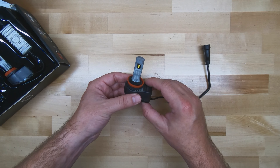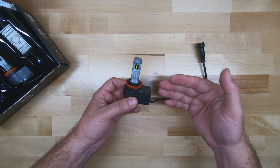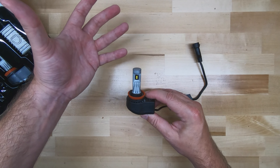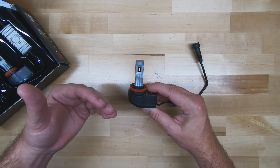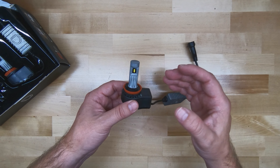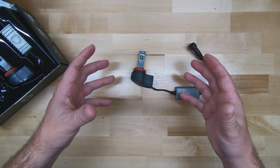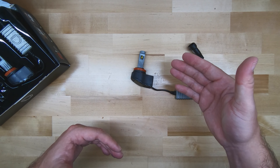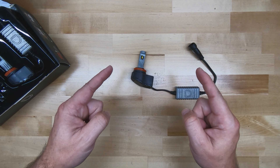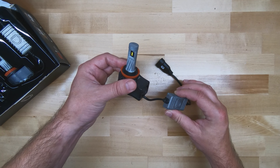These are tested and validated to SAE standards using an environmental testing chamber and advanced optical design software, which maps the entire beam pattern coming out of the headlight, not just sheer brightness out of the capsule. It's designed for both projector and reflector headlights, and Diode Dynamics publishes all of their testing results on their website. It's backed by a three-year warranty. You add all this up and you get a US-made OEM-grade headlight with optimal cooling properties for brightness, longevity, and proper focus — something you won't get from other LED headlight manufacturers right now. Let's go see how it performs.